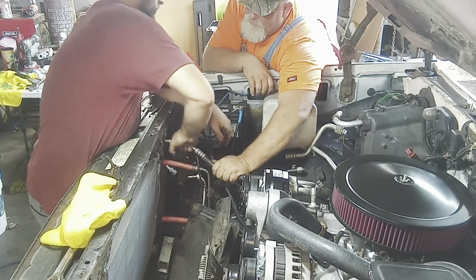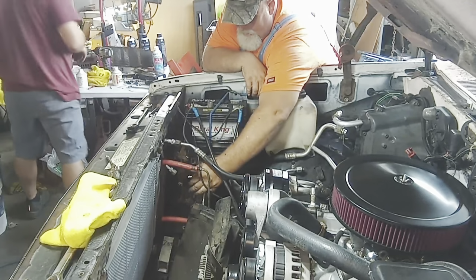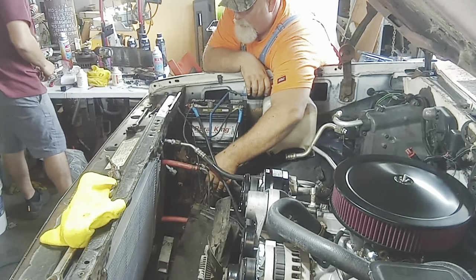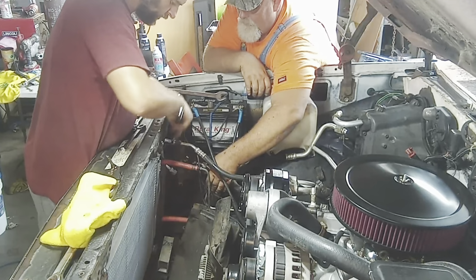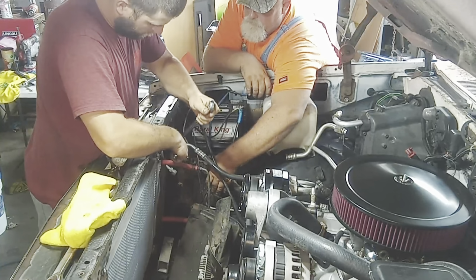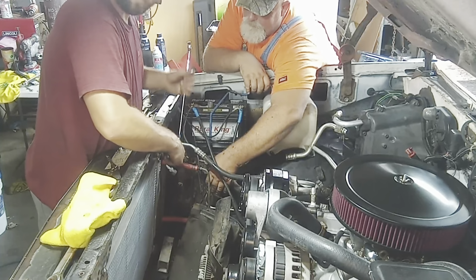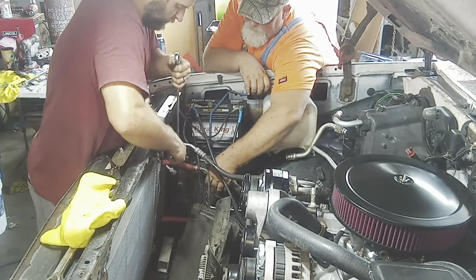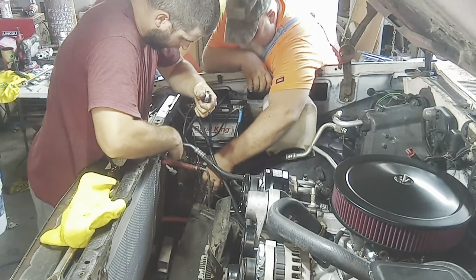We're going to have leaks all over the place. Just make it really tight. What do you think? Well, I got the wrenches. What is that? 3/4, 5/8? Probably 3/4. 3/4, 7/8. Okay. No, you didn't have any more of the fat ones that size. 3/4 on the condenser side and 7/8 on the hose side. And make sure you use a holdback. You don't want to twist that hose off your brand new condenser.